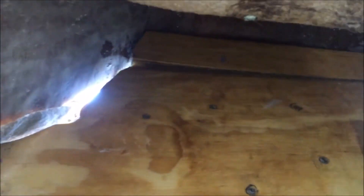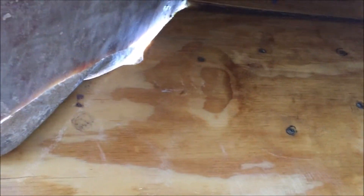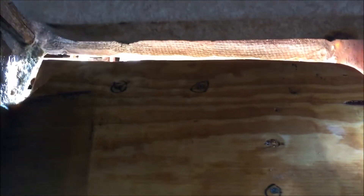I'm going to work on filling those holes up there. This one - my filler piece up there - I've already started, got that peanut buttered in. I'm going to fill the other little gap over here, put some more peanut butter in there, and then work on tabbing that in as well. Then I've got to come over on the other side and do the same thing. That upper piece up there is mainly just to help it hook to the cap - it's not really for transom strength at all.